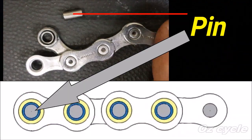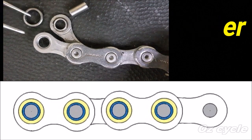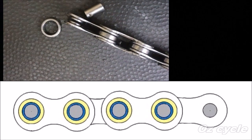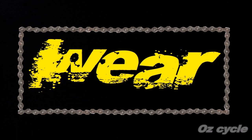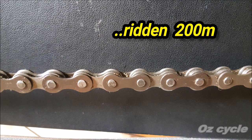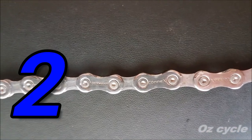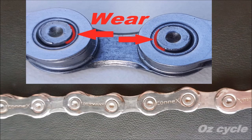Let's have a look at the parts that the chain's made up of. First, a pin. Then rollers, which come in contact and push on the cogs and chain rings. Then there's bushings, which hold the rollers into place. And the inner and outer plates, which is mostly what we see when we look at a chain. What wears your brand new chain out? Dirt! Here's a brand new chain ridden just 200 metres on a clean road — it looks clean, but dirt has already started to gather. And a shiny clean chain with hardly any lubricant isn't attracting dirt, but the moving parts within are dry and abrading against each other, also causing wear.